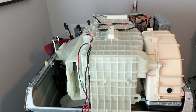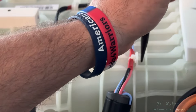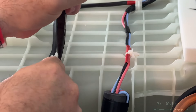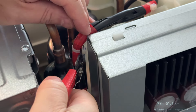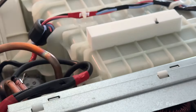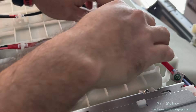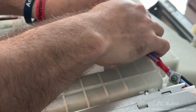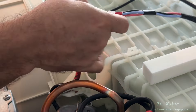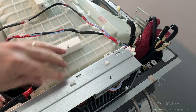We now come to the cover of the heat pump. We need to unmount but not remove the inverter to access some screws. First we push these cable tie mounts out through the plastic gently by compressing them and pushing forward. There are also two cable ties along the side of the inverter to clip, one up top. This is now disconnected and loose. We'll remove these cables from the molding to give even more slack, tracing one along the side and pushing it through.